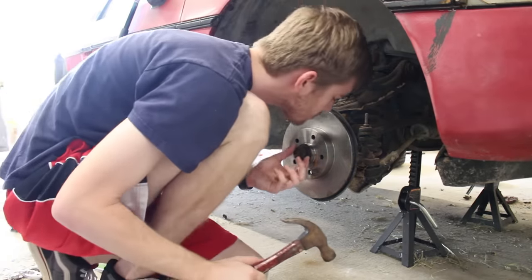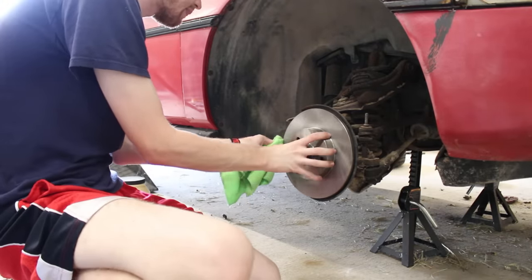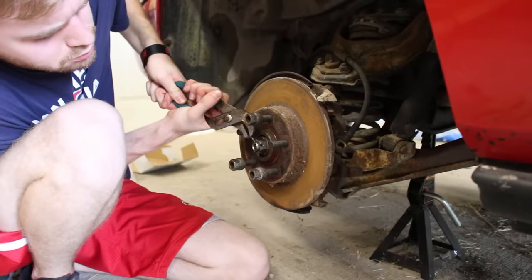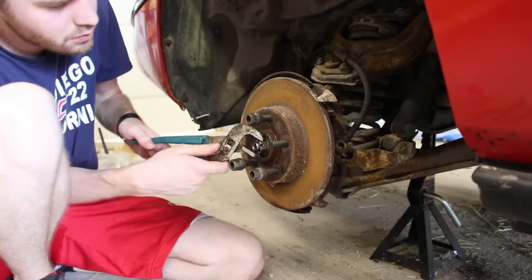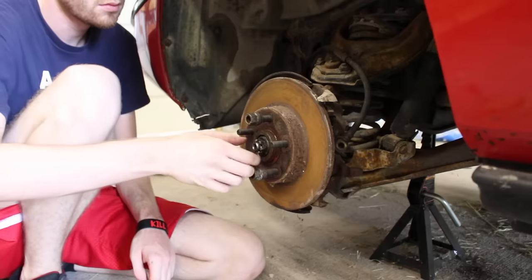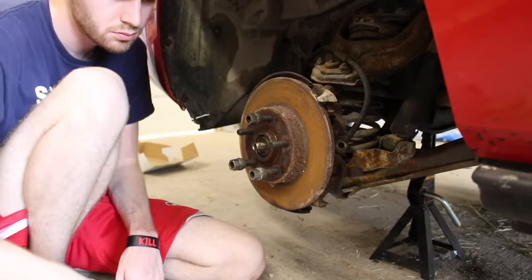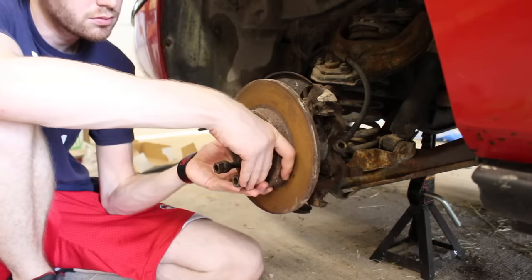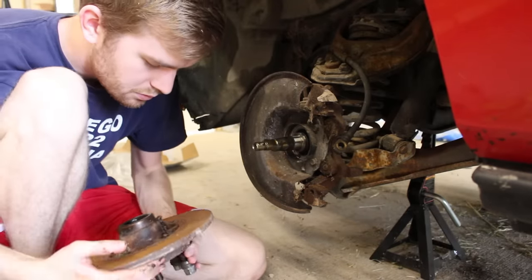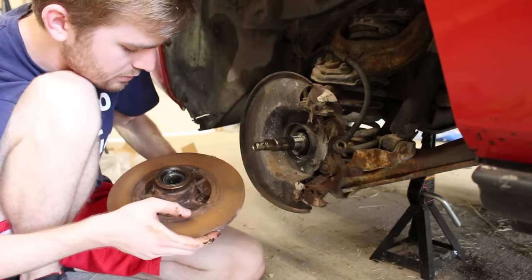Taking things a little slower and showing the whole process, let's go over to the driver's side. The cover is pried off with a flat head screwdriver, and the split pin pulled out with a set of pliers. Do notice how easy it is to break loose the nut — it's not meant to be tight, since these bearings are tapered. If the nut was tightened down to a high torque value, the bearings would be crushed and wouldn't spin properly. So with that removed, along with the washer, the whole rotor can come out, along with some tasty snacks — some dead beetles in there, and also looks like a dead caterpillar.